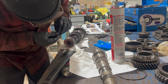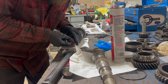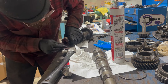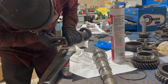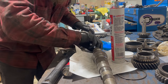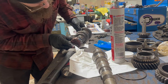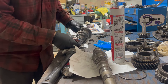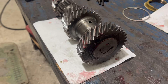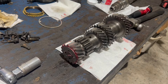You'll know you've got the right number when you get to your last one - it'll have a little more resistance before it pops into place. They do all have to be pretty straight or it won't work. Now the rollers are on the shaft, and now the washer. Pop that out this end, flip it around, and do the same thing again. Then with some more grease you attach the spacer washers to the ends. Countershaft cluster assembly is ready to install.